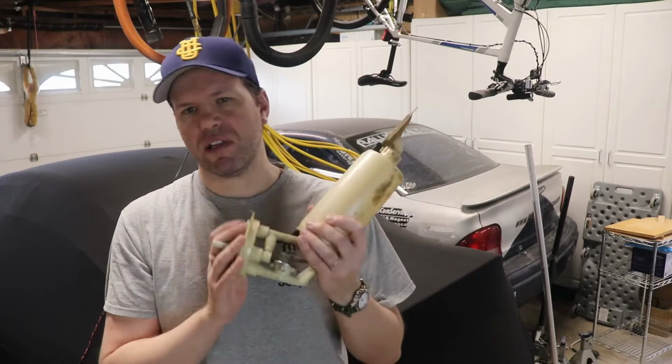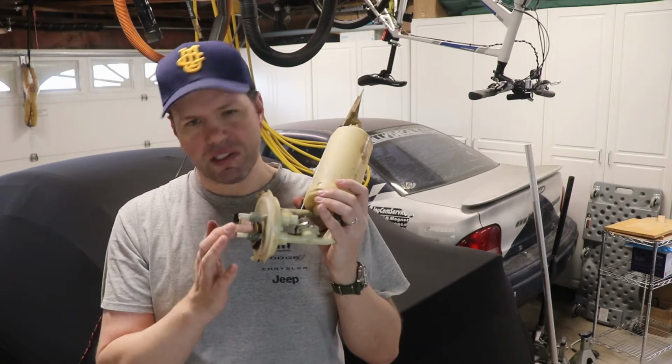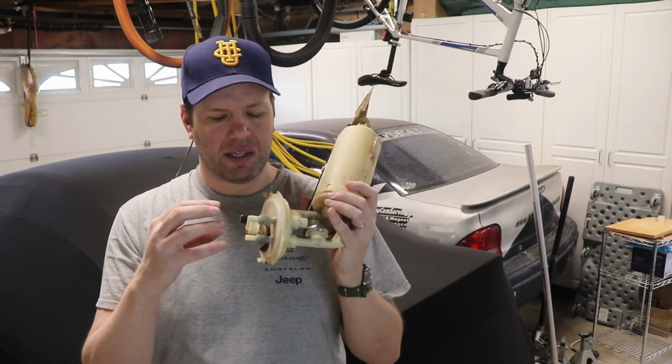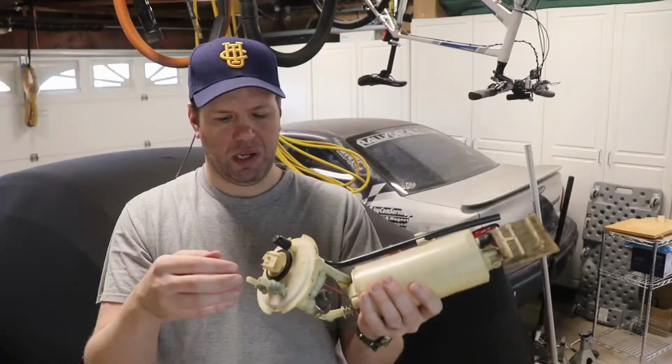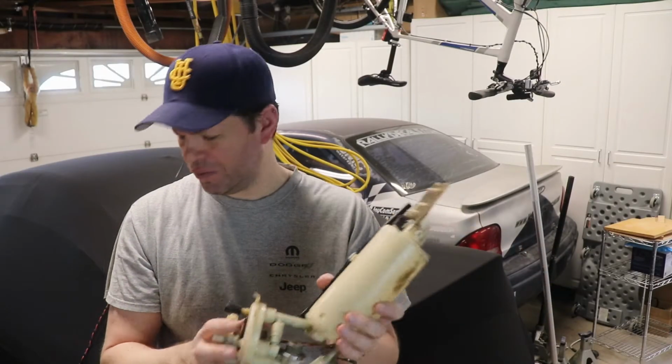But one of the things I learned is I looked up a filter for the 1998 Plymouth and couldn't find one. They don't make it. AutoZone didn't have it, O'Reilly's didn't have it, all your favorite places didn't have it. And I thought, oh no, are we to the point where we're not making replacement parts anymore? But that's not the case at all. Turns out that the newer version of this has a silver cap that has a filter and pressure regulator built into it, so we didn't need a fuel filter.